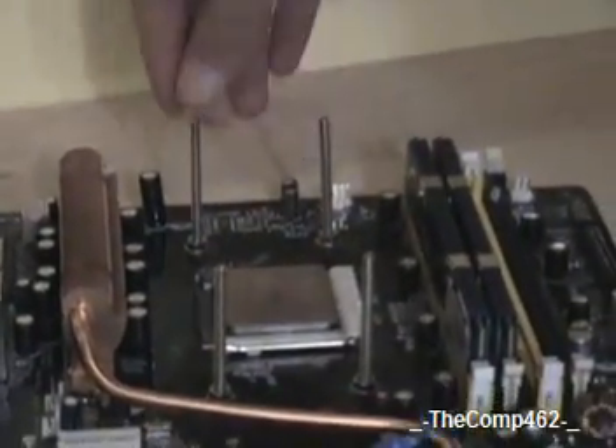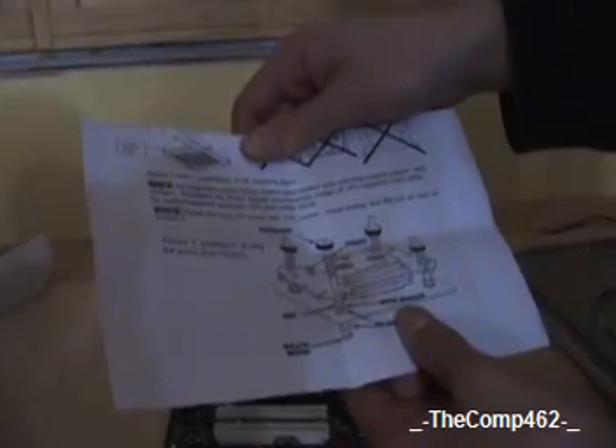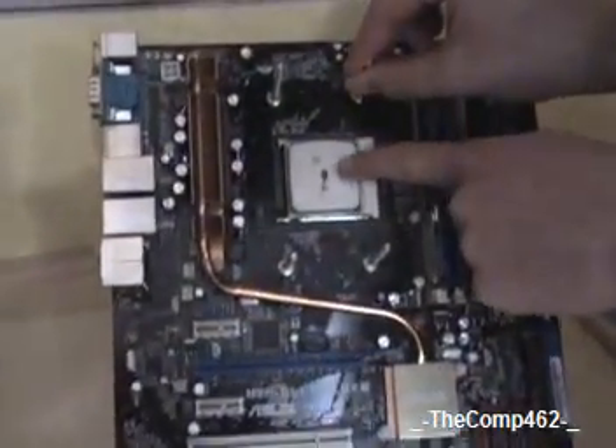Just four screws that we're going to be using to put our heatsink on. On this diagram, you can see our heatsink. It is a water-cooled heatsink, and it also comes with diamond thermal grease, so it's really high quality. We got the stuff from heatsinkfactory.com — it's the EK Supreme Universal CPU water-cooling block. The Danger Den high-flow fittings are the nipples that fit into these two holes right here. And then we have the IC Diamond 24-carat thermal compound — that's the diamond stuff we're going to put on top of the CPU. I haven't put much on it yet because that was just a test.